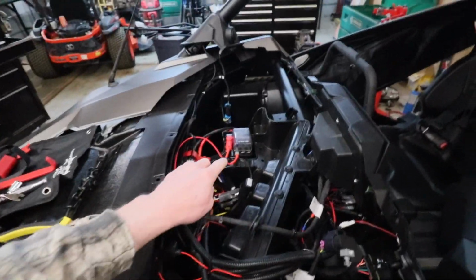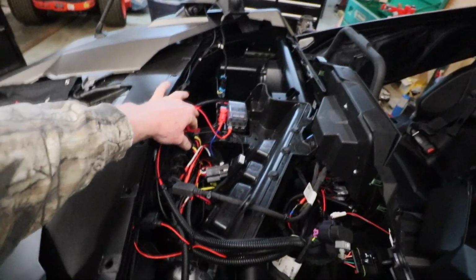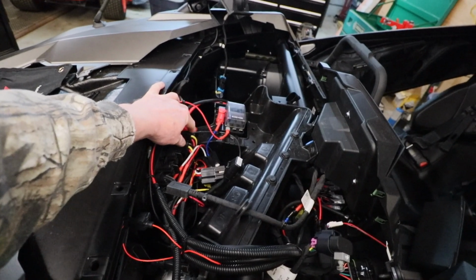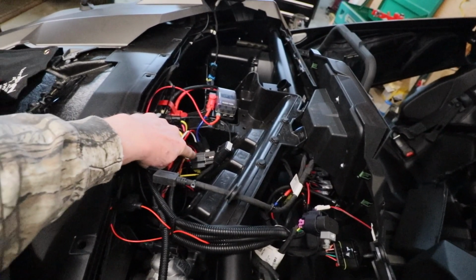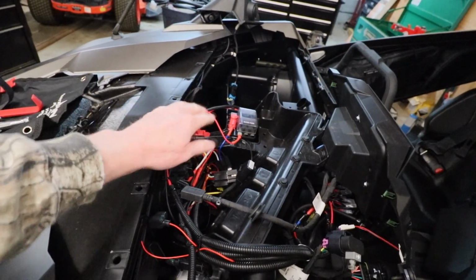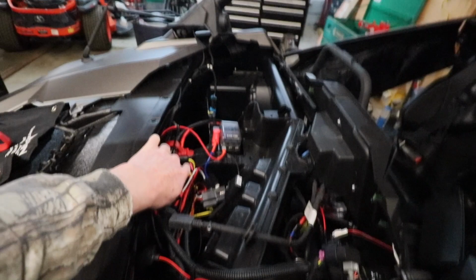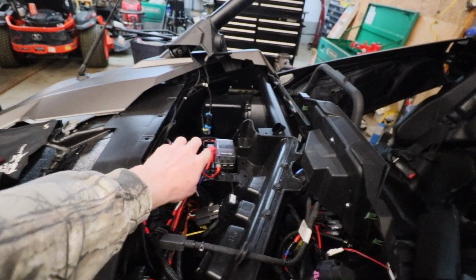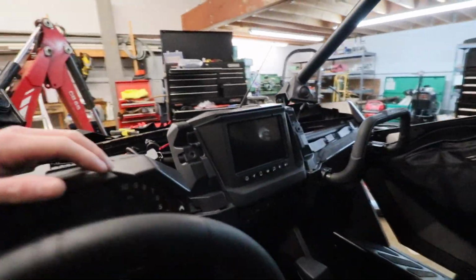As you can see here, we got quite a bit of wiring done. Got a little fuse panel plugged in. I ended up using 2 of the ports and 2 relays. So just regular automotive style relays. One of the relays, I'm actuating to turn on the light bar. It's a fairly high load. And then I split off the other relay up to a keyed-on to this fuse box. And what that's powering is all my interior accessories.